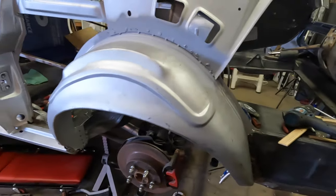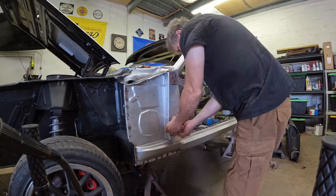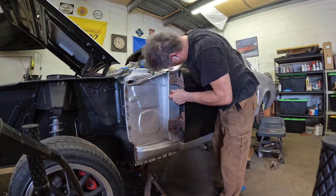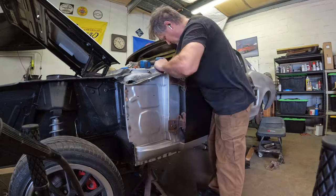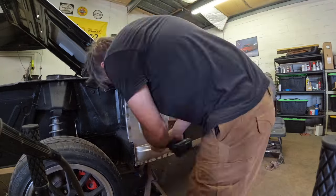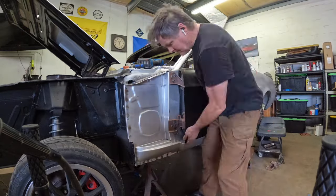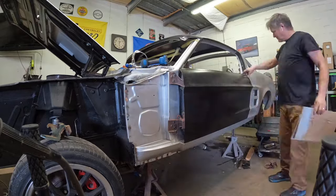We're going to put the quarter panel on now. But before we can put the quarters on the car for the last time, we need to put the doors on. I find it easier to put the hinges onto the door frame before putting the door on — it makes it easier for those inside pieces that keep falling down in the cowl. Take your time getting the door to fit the way you want it because we're going to use the door to line up the quarter panel. I've got a piece of cardboard resting in the middle of the door to give a consistent gap across the bottom — that's just how I start hanging the door.